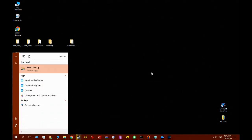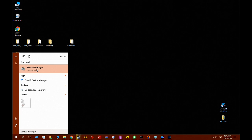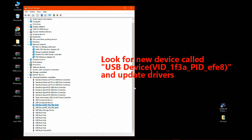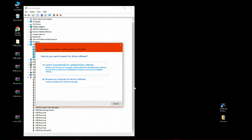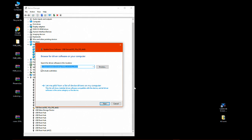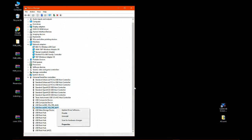We open Device Manager again to look for another USB device. This one's a little strange because it has a strange name. So again, we're looking in the list. Look for USB device, VID1F3A PID EFE8. I have two in my computer, but that's not important. Just choose the one that is there and update the driver software. Browse the computer for driver files, browse the desktop, and choose F60B Recovery Driver. It must be Recovery Driver this time. And click Next. If this does not work, choose Other Recovery Drivers, and the links are below in the description.